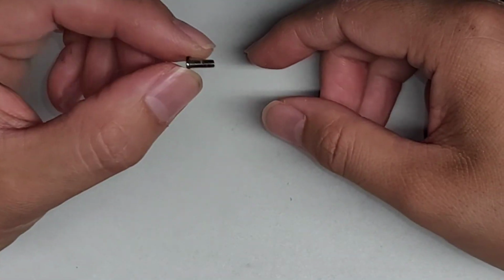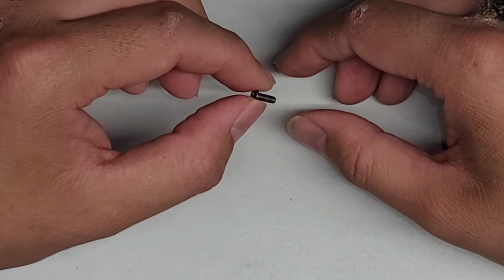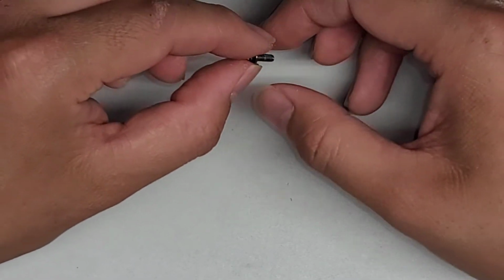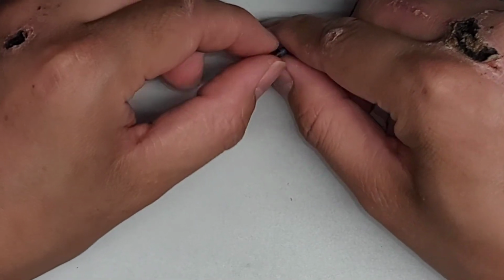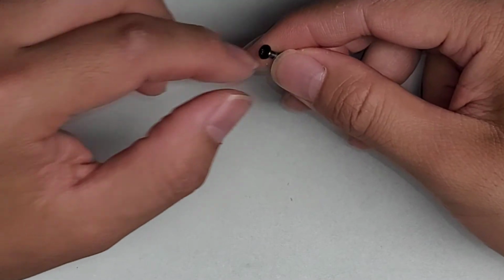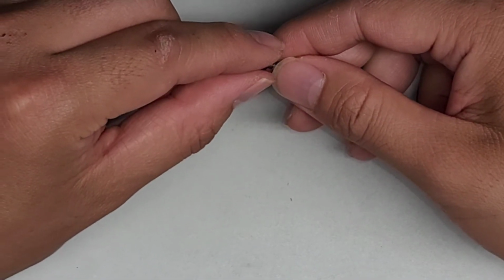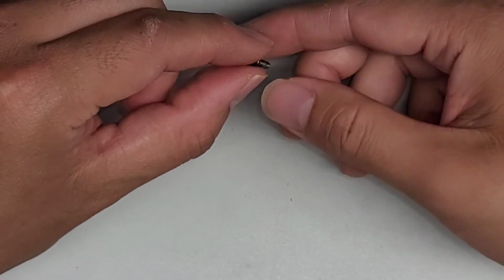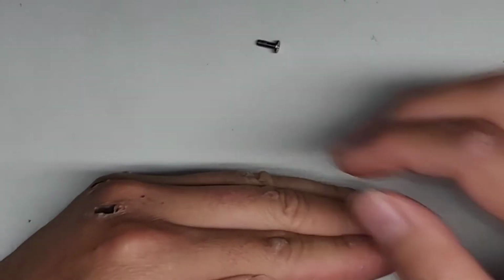But yeah, on almost every other laptop where it's plastic on the outside, they have plastic just around those brass mounts, and then the plastic cracks from the prying force and it breaks. And again, it usually happens because the screws come loose, and then when the screws come loose, instead of a smooth motion, it's more like a sudden prying force. Kind of like how when you have nails in a piece of wood and then you get the back of the hammer, you need to suddenly yank on it.